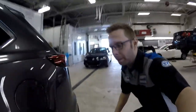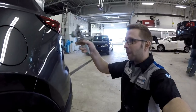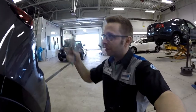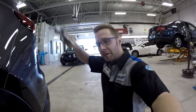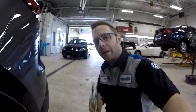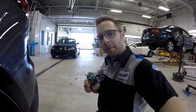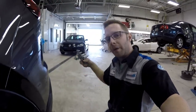An interesting fact when painting this bumper cover: normally when you're painting, what you do is you just march across the panel. Like if it's a panel like this bumper, I'll just start here and do about a 70% overlap with my color. With this specific color — this quad stage color from Mazda — I do my normal overlap, but then I have to do what's called a double cross coat. Then I come the other direction using that same overlap and go around the panel one more time. On a metallic like this we also do what's called a control coat. Some of the metallic might get mottled and kind of grouped together as it lands on the panel, so we turn down the air pressure going into our gun, take the distance back further, and just mist a coat on there — and it evens out all the metallic.